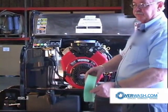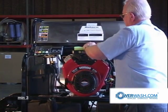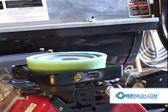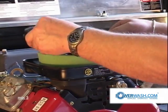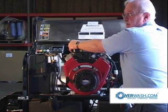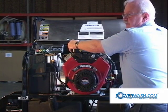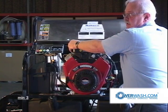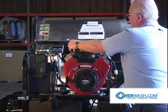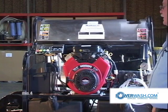Then you inspect your pre-filter. If it's clean, you simply replace it. If the pre-filter is dirty, you clean it or replace it. If you're going to clean it, you can't reuse it immediately — you'll clean it with soap and water, blow it out with air, and wait until it dries. When installing a new pre-filter, lightly spray it with WD-40 and wring it out in a towel. Put your breather cover back on, put your catches in place and snap them over. You now have a clean air filter to work with.